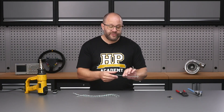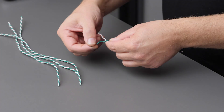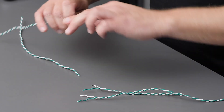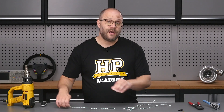So don't stress if you're performing a splice like this and you've got straight wires just being pinned into your connector. The first thing I'm going to do is untwist a good section of our wire — between 30 and 40mm — on all of these. Then we're going to trim the ends of the wire to give us our stagger.